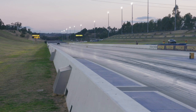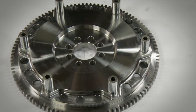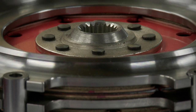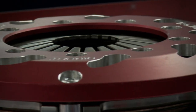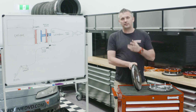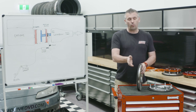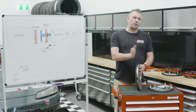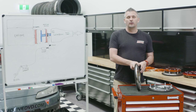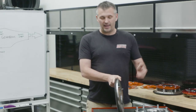Now another thing to consider with a flywheel is its ability to hold heat. If you've taken all the weight out of a flywheel by drilling holes into the outer part or making it thinner or getting rid of the dual mass part on the inside — the thinner you make it, the lighter you make it, the less ability it has to hold heat. Now if it can't hold heat, what's it going to do? It's going to distort, bend, and warp. If it warps, it doesn't have as much contact patch — it starts to slip and can also make funny noises and start grabbing. So when it comes to lightening a flywheel, sometimes it's a bad idea because it can't hold the heat.